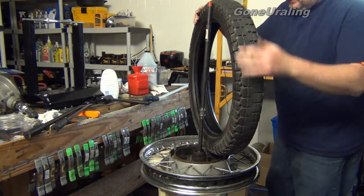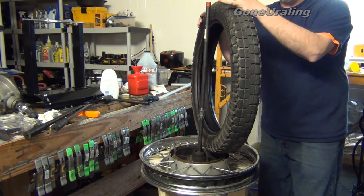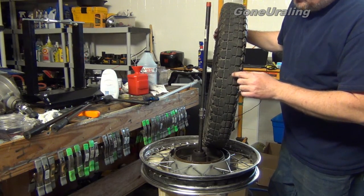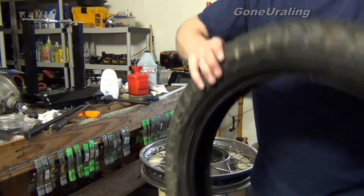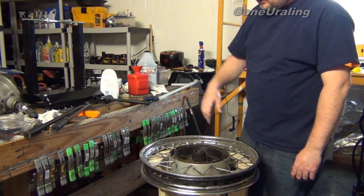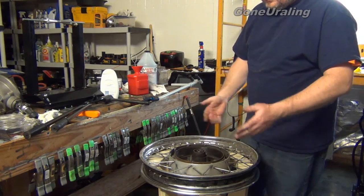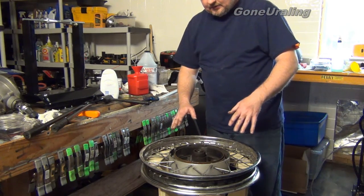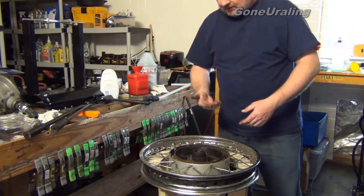Out of six tires I needed a spare. I bought six new ones. I pulled one of the good ones off the Tourist to make a spare for the Patrol. This pusher is a Duro — an inexpensive tire — but it's still in good shape, so I'll put it to the side and keep it. The rest will go to recycling; there's almost no tread left. Now I'm going to put the wheel on the balancer stand, clean it, check it for trueness — less than a tenth of an inch side-to-side wobble, which on a steel rim is a bit of a challenge. Grease the nipples, then bring it back and put the band on to get it ready to mount the new tire.